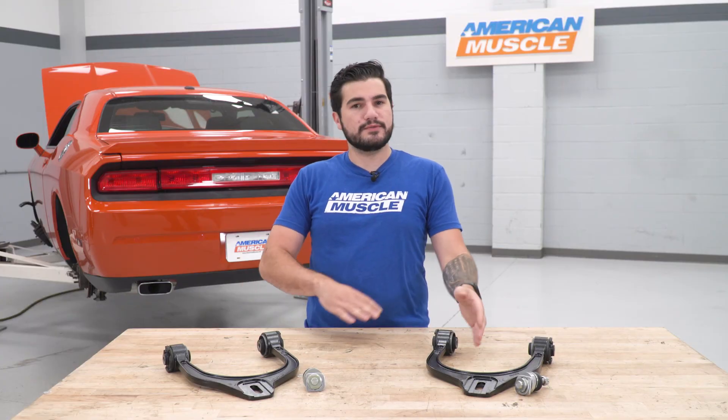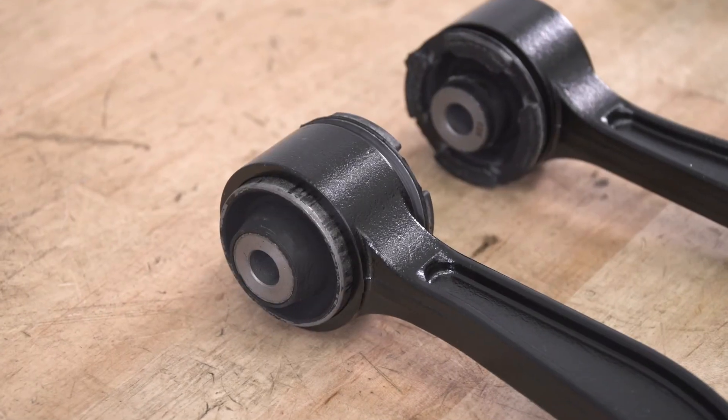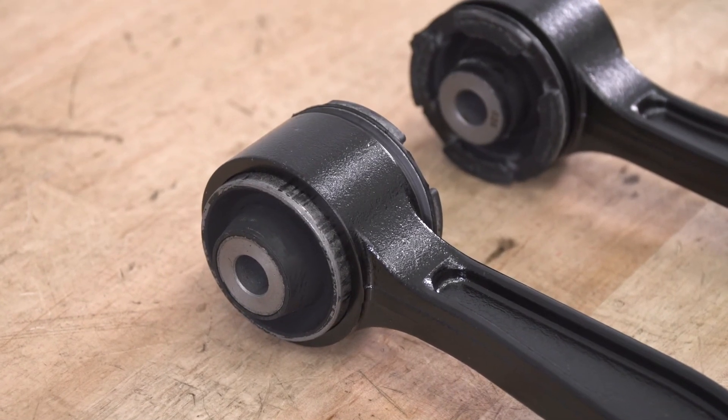When it comes to camber position, that's the in or out of your tire and wheel position. If we're talking about toe-out or negative camber, it basically means you're going to have uneven tire wear — your tires are riding on a small, thin patch of the inner tire, which is just going to wear it down a whole lot quicker, sacrificing ride quality and traction. With these, you have full adjustability. Note that the kit does come as a pair, coming in right around 400 bucks.